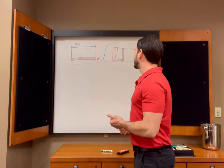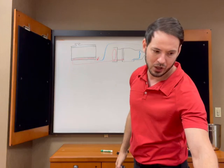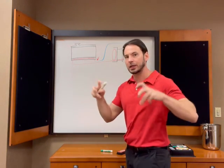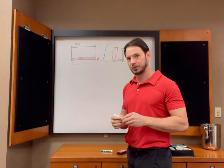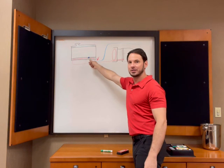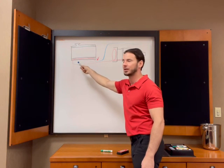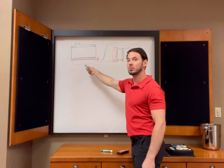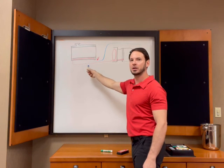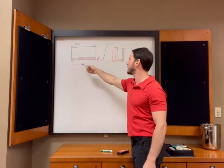Cool. Well, here's a real interesting thing that most people don't realize: the primary cooling of the automatic transmission fluid takes place not in here. Remember, this is a temperature stabilization device, and there's not really that much fluid in here. Flow through this should be about one GPM. I think that's right, on an SVX transmission with a good TPS at idle, you'd have about one GPM through here.